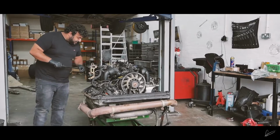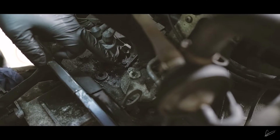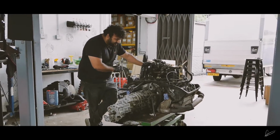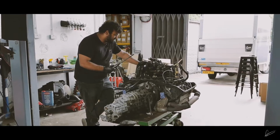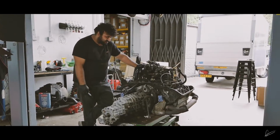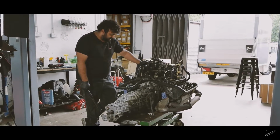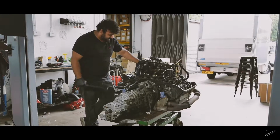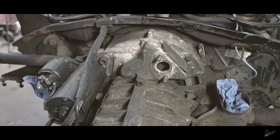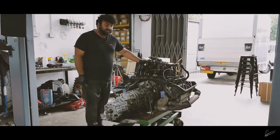Moving towards the back, the oil sender is leaking, so we'll replace that gasket, which is pretty straightforward. There was some oil in the intake manifold, but apparently that's from overfilling the engine, so that should be fine when we give it its oil service. And that's pretty much it on the engine that needs doing, and then just a really thorough cleanup. And I guess we will repaint some other parts. But overall, it's in quite good condition.